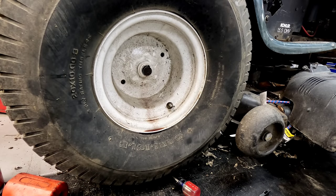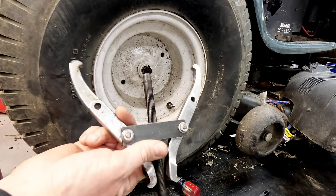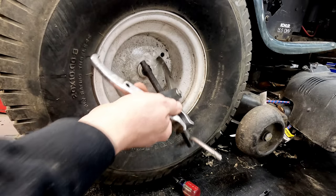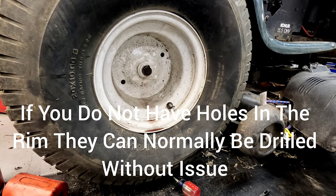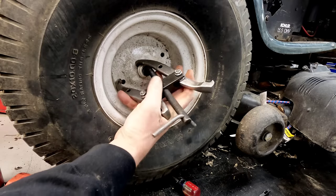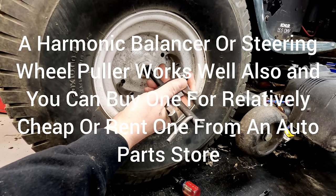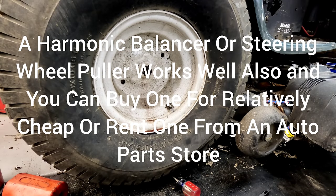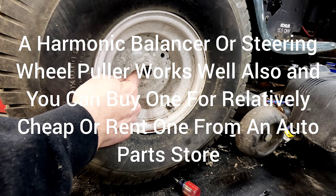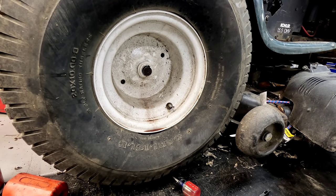If you don't have that available but you've got a puller sitting around, these holes may not be big enough, but you can always widen those holes a little bit with a drill bit, get your puller in there, center it on the shaft, and that'll pull it off. That also keeps you from having issues with the transmission being ruined because you're not putting any pressure against that aluminum housing of the transmission.